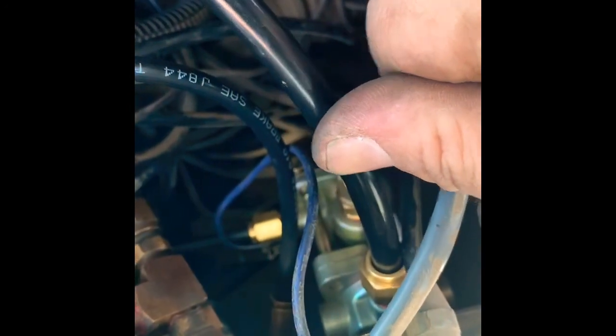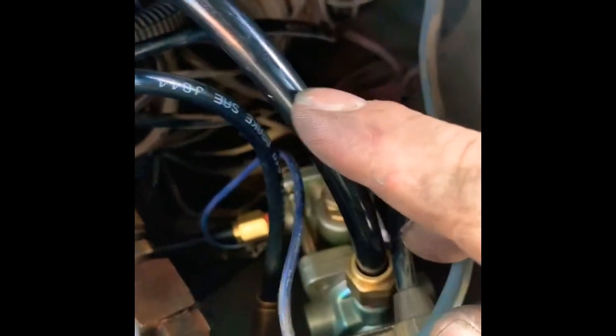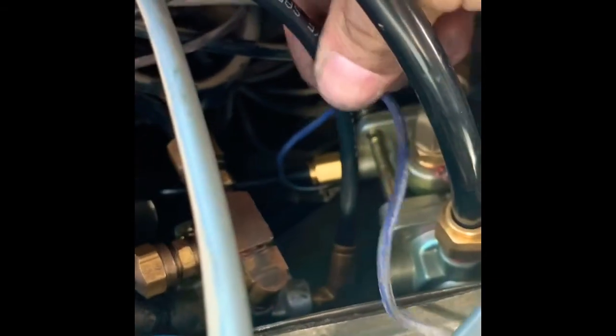All right, so there she's mounted. A lot going on in here. This would be supply, goes to supply. I teed it in over there. But it's hooked to supply off your tractor valve and your trailer valve. Those are hooked together. Those are supply. That's 3/8. Then you have a delivery port coming off here, off your tractor valve. That's 1/4 inch. That's gonna go here